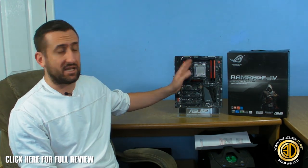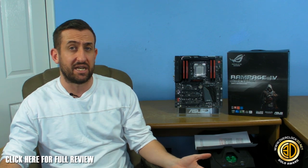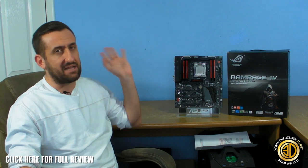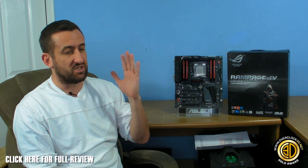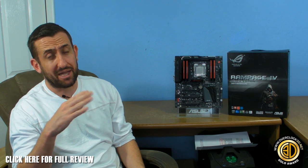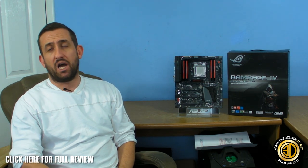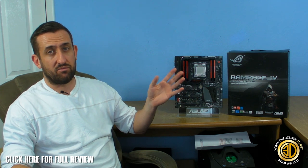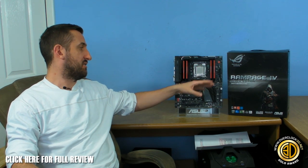Now, although my 4960X will do 2400 without breaking a sweat, and I can tune all the timings down to within an inch of their lives, the memory controller on that has just not got any more than 2550 megahertz in it. And that's the most I've managed to eke out of it. And that was with a 2400 base and then playing with the base clock to move up. Talking about base clock, it will do the same as that chip did on that. It's 140 megahertz. And that's obviously a huge difference, but I had to drop the multiplier right down just so I was just playing with the megahertz. And exactly the same usable overclock as well, which I ended up using: 46 multiplier, 100 base, 2400 megahertz on the memory.